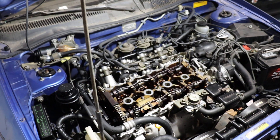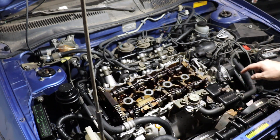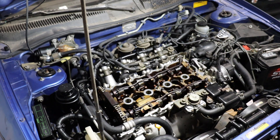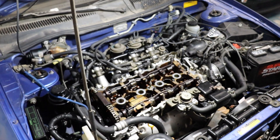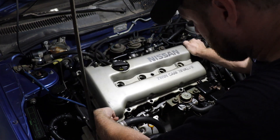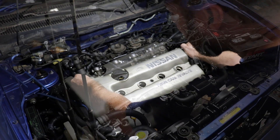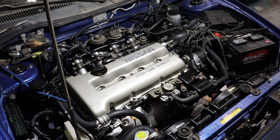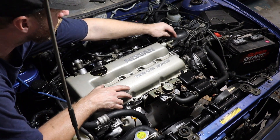Now it's time to apply a little ultra-gray RTV to our valve cover area where we're going to be placing down the new gasket. Again, I only like to put it down in these areas that go around the cam sections and over where that small half-moon goes, and then in the corners — I think that's all you need. Don't go overboard; you definitely don't want any of that falling inside your valve train. Just smear it on there sparingly with your fingers. You don't need to do the whole perimeter like the previous person did. I had to pull off a little hose in the back that was fouling as it went down — that made life a lot easier. Now we just have to massage everything into its right home.